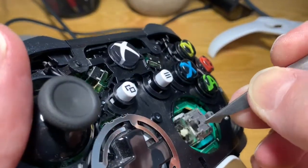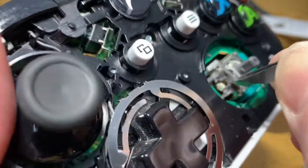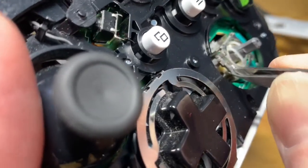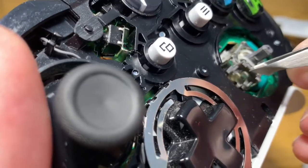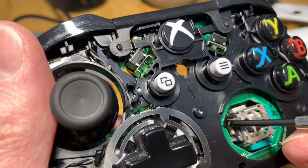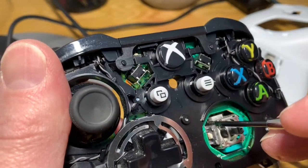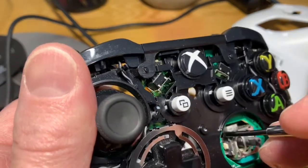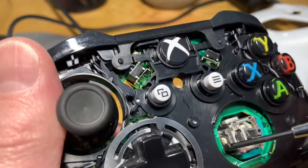This is going to be a little awkward — it's a little bigger than this green circuit board. That could be a problem if I wiggle it around. I'm going to have to try something else. There we go, I think I got it. Basically I just kept using a flat bladed screwdriver and wiggled one edge under the green board and the other edge in. There's a little tab down there that fits in a slot on the white. I kind of wiggled that in, and lastly on top there's one other small tab. So I just kept wiggling and prying and cramming it in there and then it snapped in. I hope now that this whole side gray piece is snapped in and good.